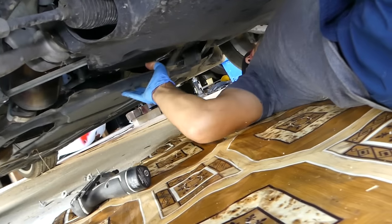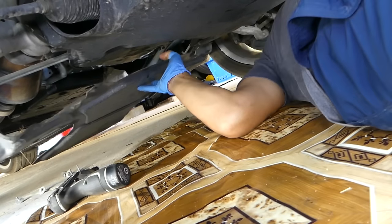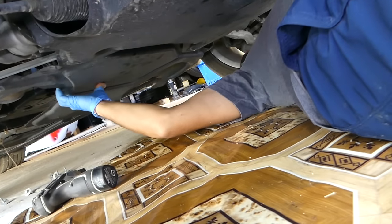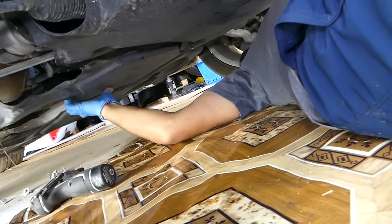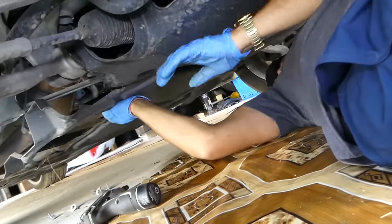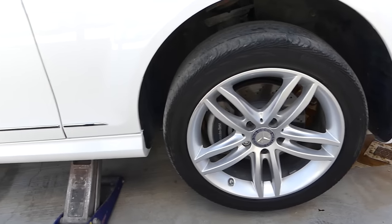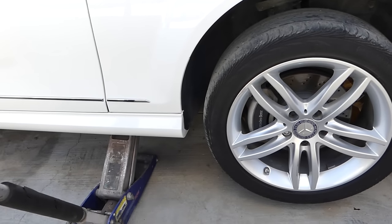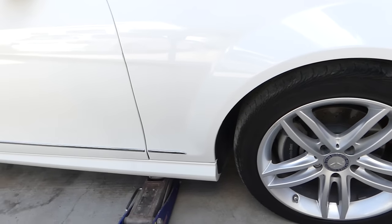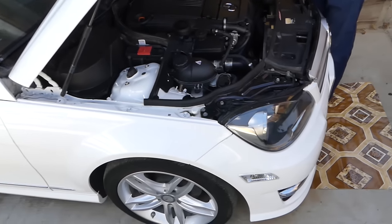Next, on the bottom we need to reinstall the plastic cover. The rear cover goes underneath and the front cover in front — that's very important. Align everything and install the bolts we removed. Make sure nothing is left under the vehicle, everything is tightened, and nobody is under the car before dropping the jack. The car is now on completely level ground so we can add oil and measure the oil level.